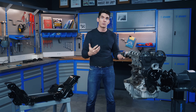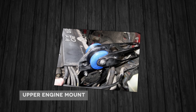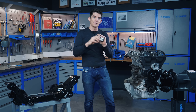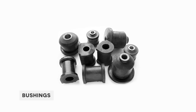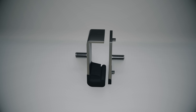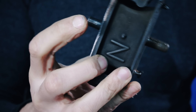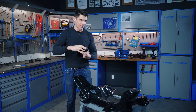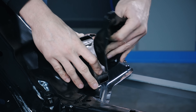Upper mounts are a more refined version of the chain used in muscle cars, and normally these are a tie bar with rubber bushings to isolate vibration from the bodywork. A bushing, incidentally, is a cylinder of rubber that acts as a vibration absorber where two parts are bolted together. Simple mounts like these are made up of two separate metal plates laminated together by a chunk of solid rubber. They can be block-shaped or disc-shaped. Studs are welded onto the plates, and note that these studs don't run through the rubber. One plate bolts onto the subframe and the other onto a support bracket which attaches to the engine block.